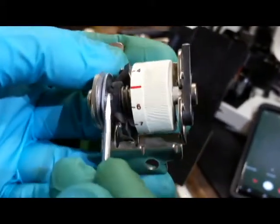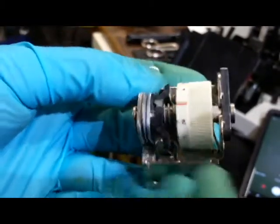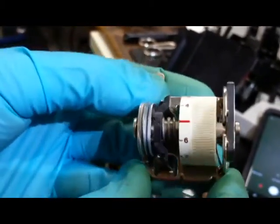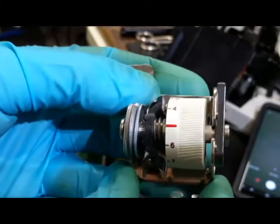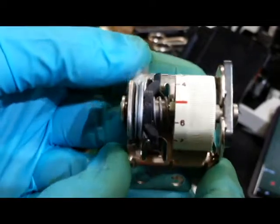What we've done is we've added a teensy amount on the shaft — a teensy amount of lacquer thinner — and we move this back and forth to kind of loosen the oil varnish. Then we wash it out with mineral spirits and put it back in place.